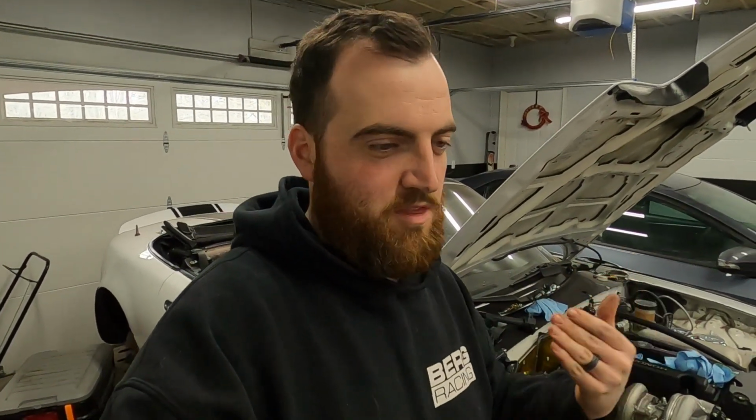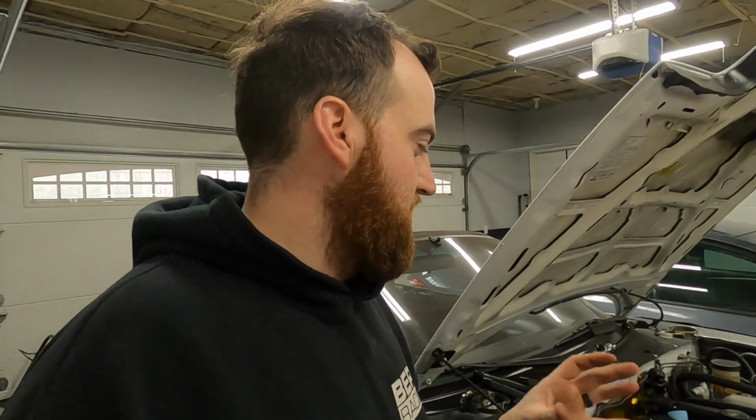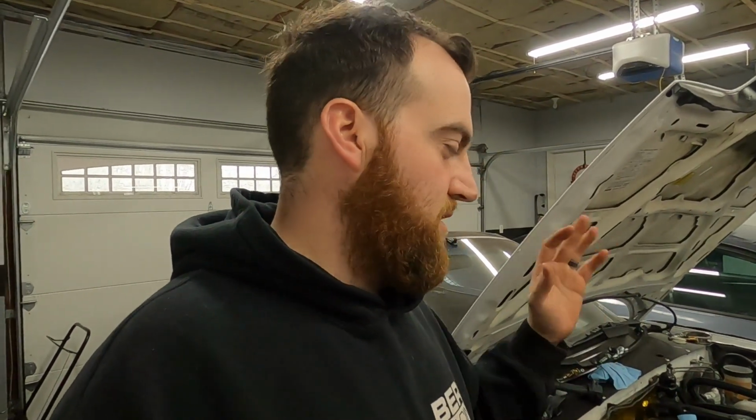The bottom, with where that clamp is and was on the original downpipe, it's kind of a tight spot, but you can actually access it pretty well from down in the fender well, so that's how I've been finishing putting it on. You line it up top, get it underneath, and the nice thing about the V-band I have down there is it's a quick release, so it's really easy to snap together. But I'm very stoked to have all V-bands on the whole, really everything, especially on the exhaust.